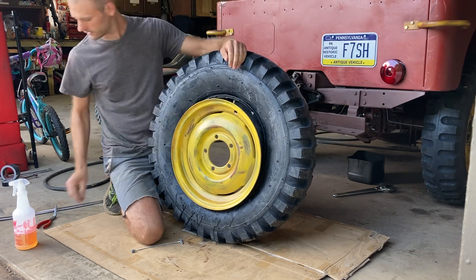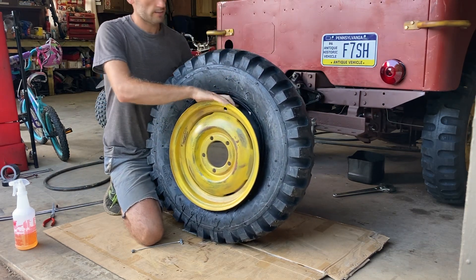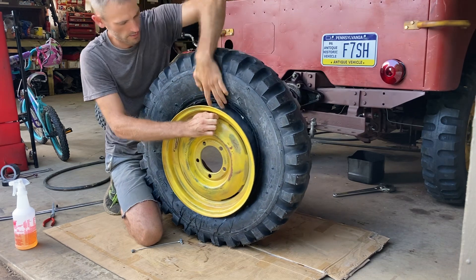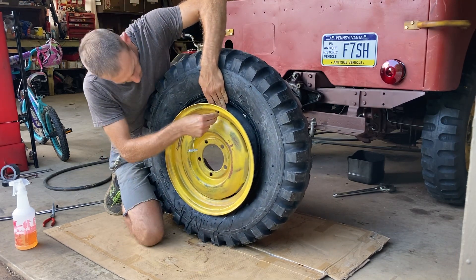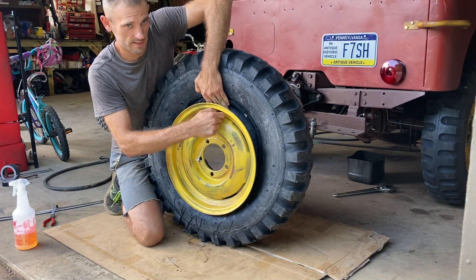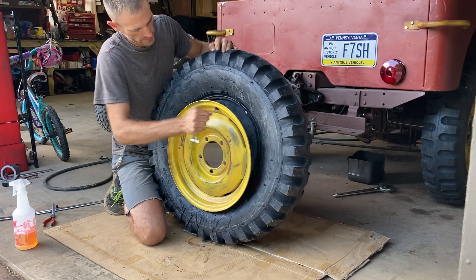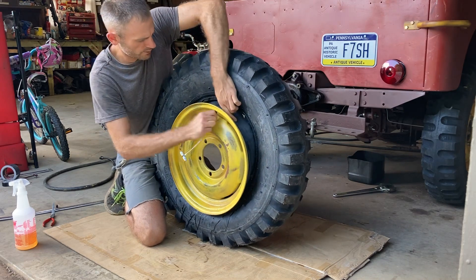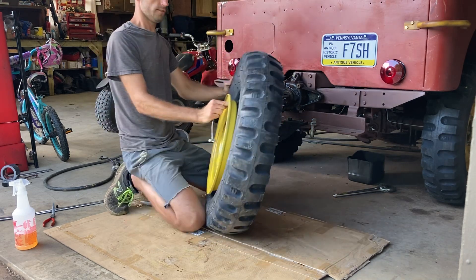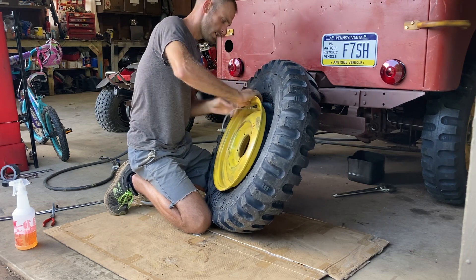Take the cap off. You should be able to turn the rim. Take your valve stem and push it through the hole. Use some kind of tool that threads onto your valve stem, because once you get the other bead pressed on you don't want to lose your valve stem. Wiggle it through the hole — you can roll the tube the way it needs to go without pinching it. If you don't do this, sometimes when you go to put air in, it will suck the valve stem back in the hole and you don't want that.